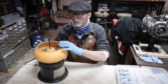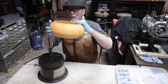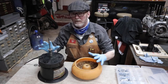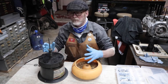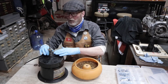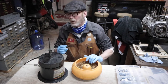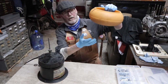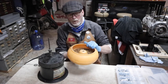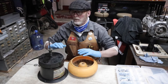As an additional tip, you're going to be putting a bit more weight into this machine than it may or may not have been designed to deal with, between the weight of the parts and the weight of the gravel. So, a lesson we learned the hard way is you want to measure and place a washer stack on this arbor that matches the distance from the bottom of the bowl, these rubber pads here, to the underside of this center cone,